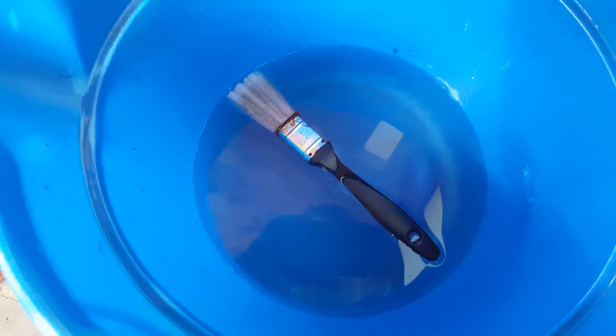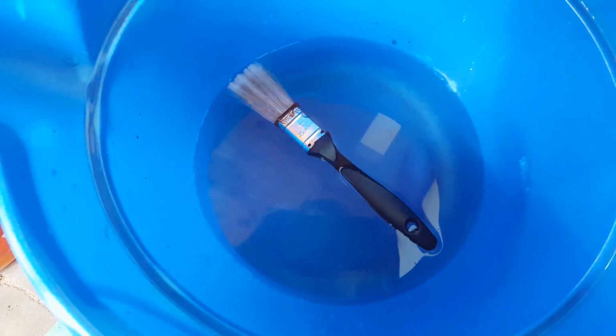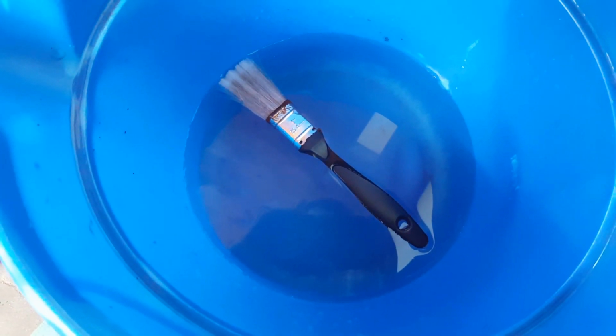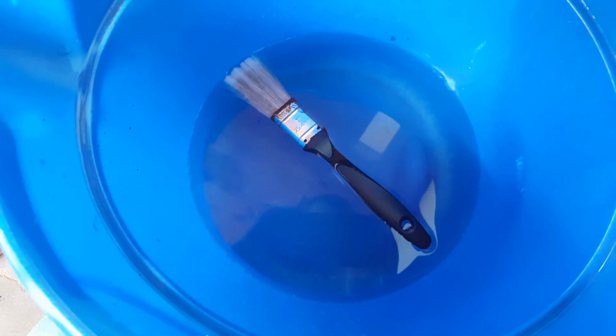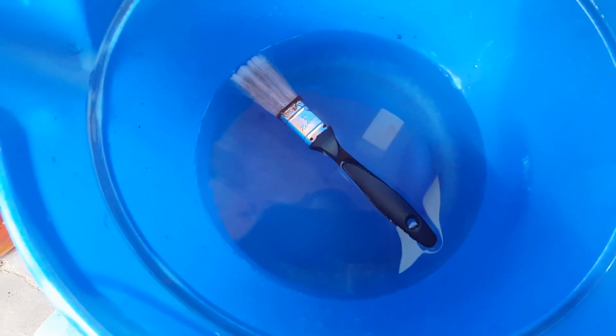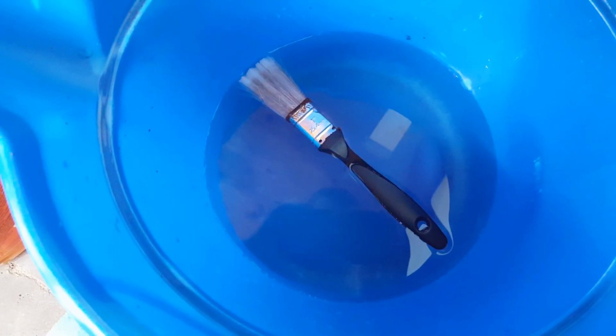Now to clean inside the crack at the door there, all I used was soapy water and a paintbrush, because you really can't get a sponge or a rag in there real good. And the rubber seal has most of the filth stuck to it, so you want to scrub the back of the rubber seal real good. And here you can see I got one of the drain holes cleaned out. This is after I used a paintbrush and the zip tie to clean out the hole, and a paintbrush to scrub.